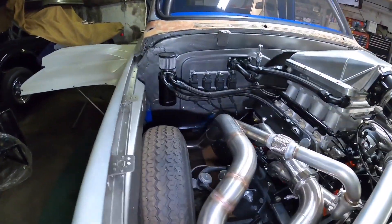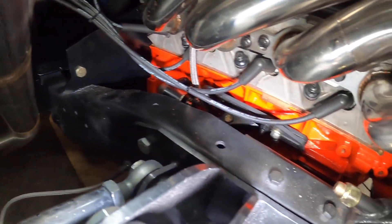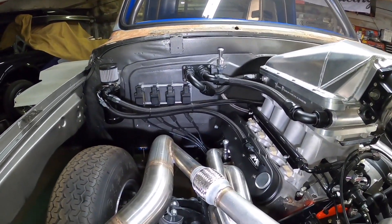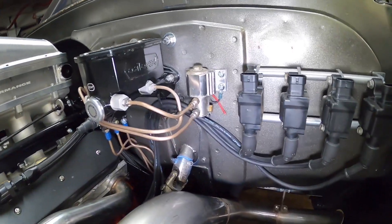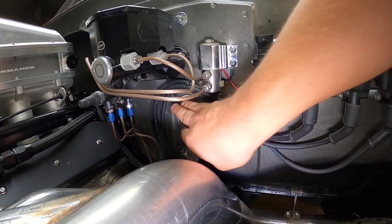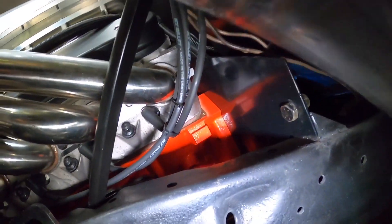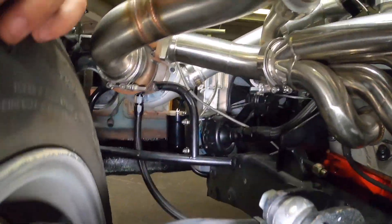I've got the plug wires on the truck. They're all on — passenger side is a lot neater, only because there's no master cylinder or anything like that and the lines are shorter since they're closer to the engine. On the driver side they're spaced off a little more so the lines are longer, and I had to route them up over the steering column. I'll get a clamp and tie that up nicer than the zip tie that's on it now. Down here you can see they're not near the headers or the steering column anywhere — nice and tidy, tucked away.